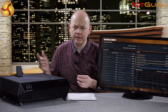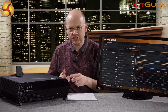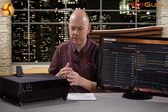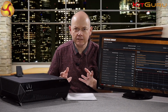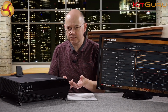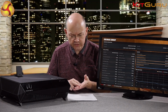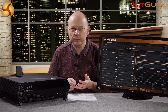The graphics card in our hand, the Asus GTX 1080 Strix, is nice and quiet, but nonetheless it has to shift plenty of hot air. So you put a decent amount of hardware in a relatively small space, albeit this is not a tiny chassis, but nonetheless, the result is you've got to shift the hot air. The result in this instance is the processor cooler is working relatively hard. It draws 80 to 100 watts on the Windows desktop and 265 to 280 watts in 3DMark.